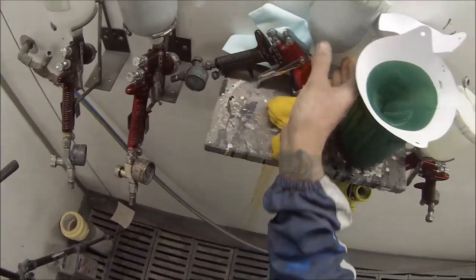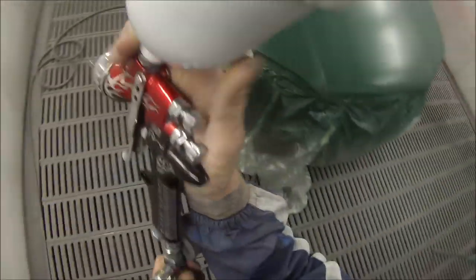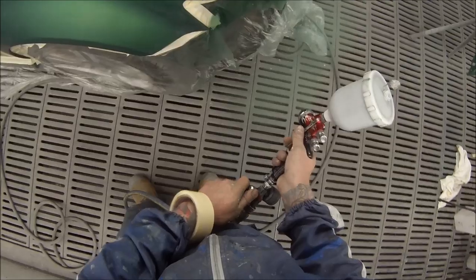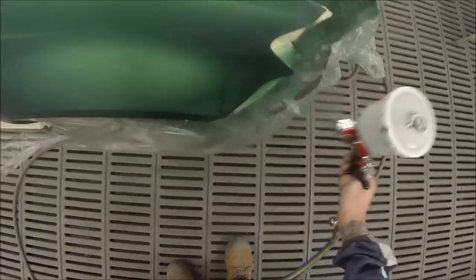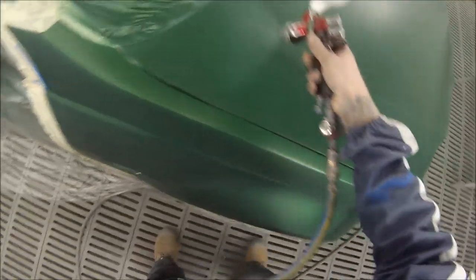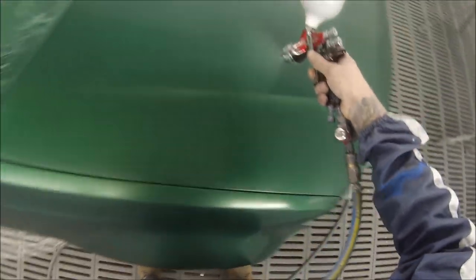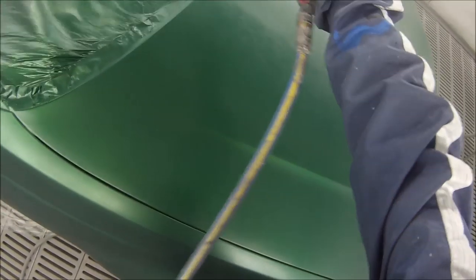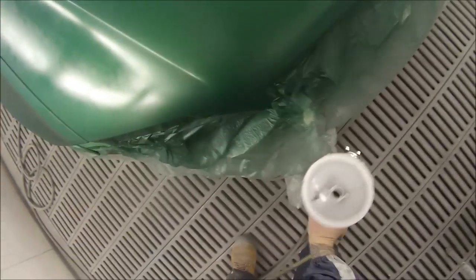Just unmasking that. It's taking a little bit longer to dry because I've already got a coat of base coat underneath. Next up, we'll put our top coat colour in. I've got the spray booth turned up to about 25-28 degrees, and straight away you can see it's already starting to look covered. From memory, I ended up putting a couple more coats of colour over the top because it wouldn't be 100% covered. You could get it out in the sun and find the bonnet and fender are a different colour.